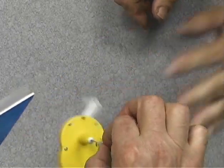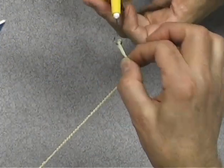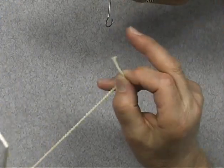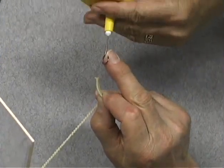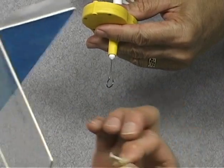So go ahead and let go of the winder. So he's letting go of the winder, and go ahead and grab it again. We're doing this because the same thing happens here. Sometimes these winders have a very sharp edge on there, and you don't want to nick the motor, because that's going to really shorten the life of the motor.